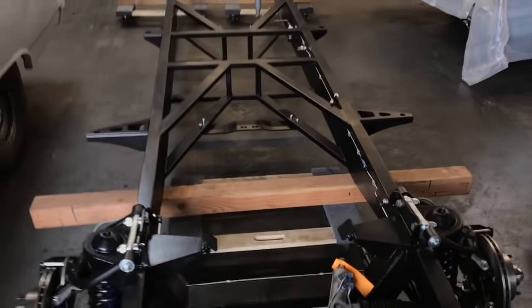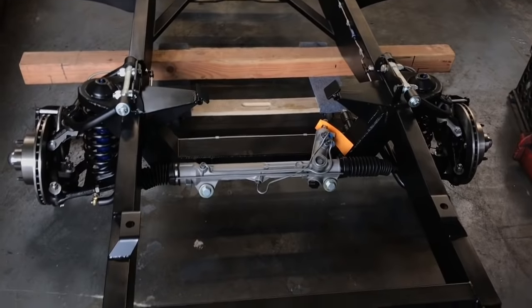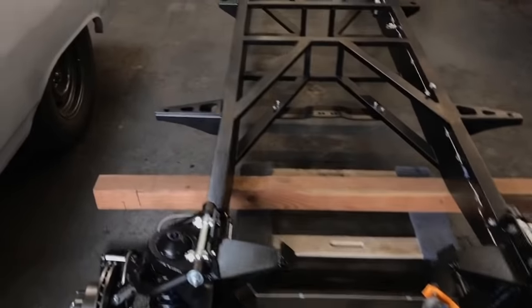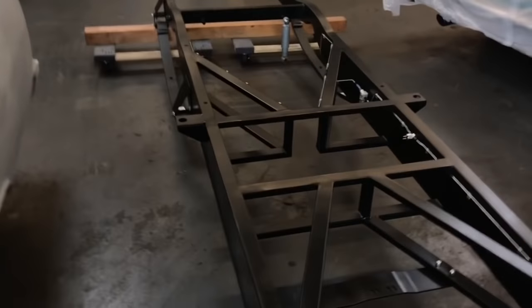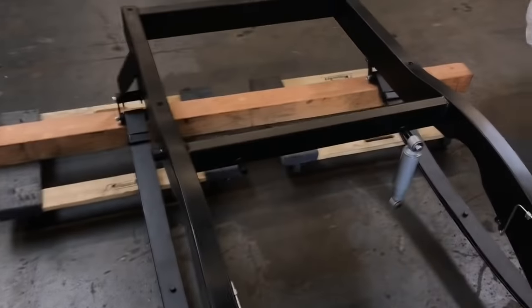I might have to update that motor. I fired it up yesterday, and after it sat for a couple of weeks, it was just blowing a ton of gray smoke. Generally that means valve guides are garbage. Right after that, valve guides will start falling down and punching holes in pistons, so not good.